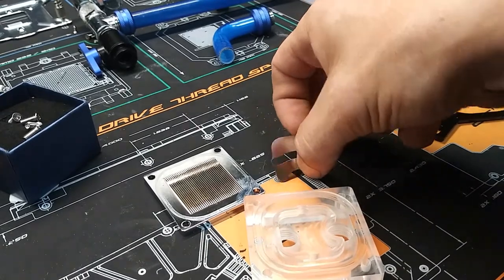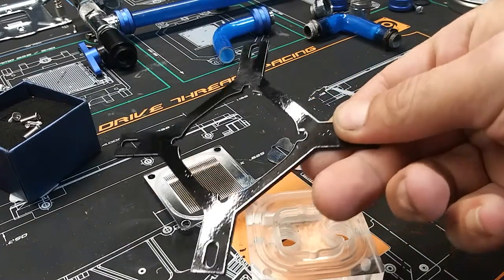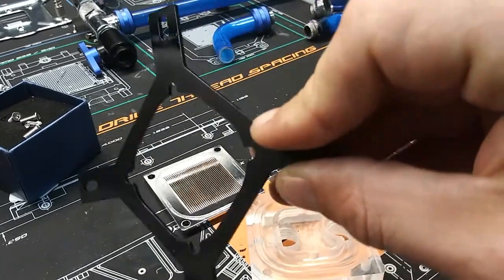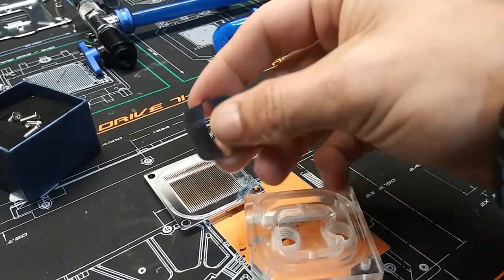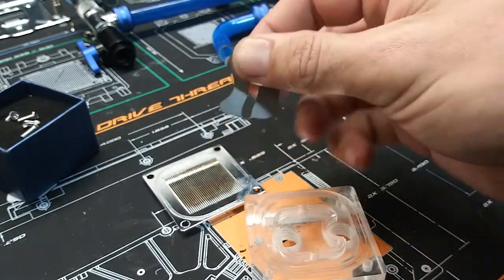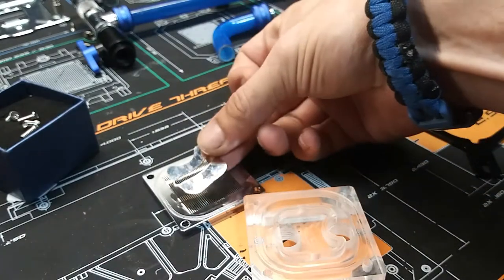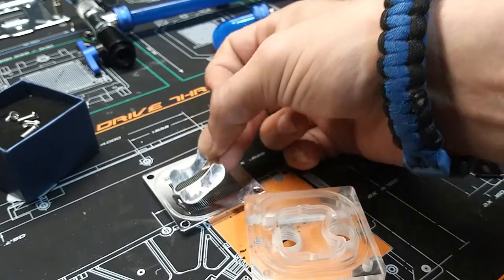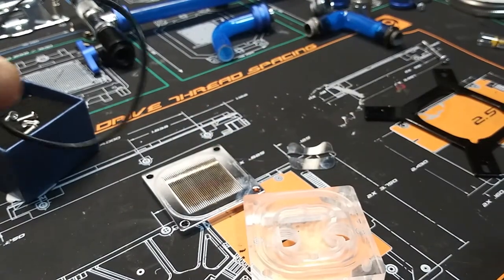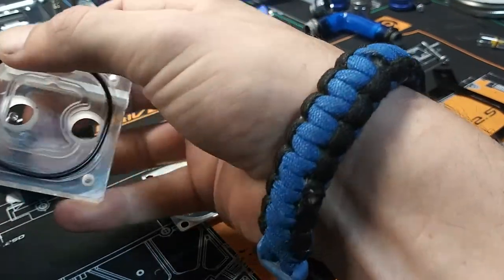I was like, you know what, I think I'll use that CPU block. I'm going to have to do a couple of things — for one, I painted this. This right here was chrome and I didn't want it to be chrome; I wanted it to be black. Right here is your flow smasher. Basically what it does is your water will flow through there, come out the other side, and press against those fins, causing the water to go through the middle and out through the fins — that's the point of this thing. And don't forget the O-ring — you gotta have one of those.